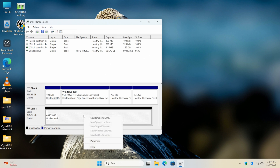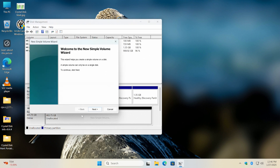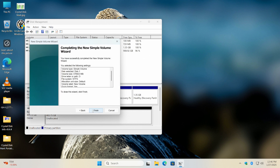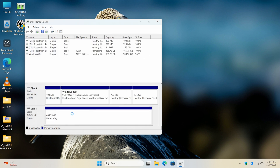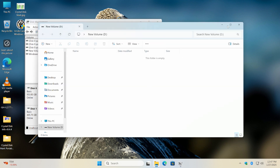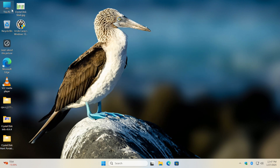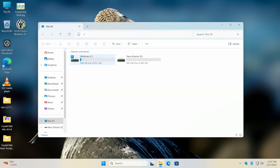Click OK, then right-click on the unallocated space down here and select 'New Simple Volume.' Click Next, Next, Next, Finish. Now we have a D drive — the next available letter after C. If you already have C, D, E, F, and G, then this drive will become H. It's not the same for everybody.